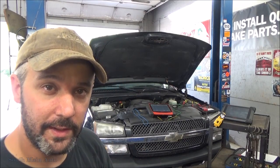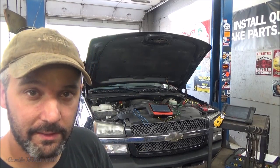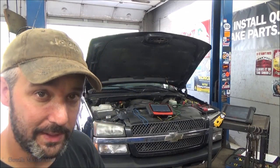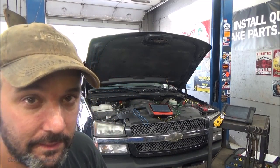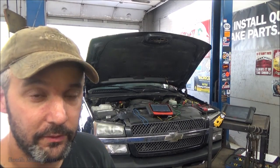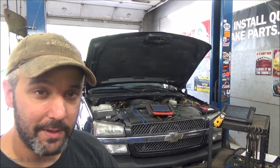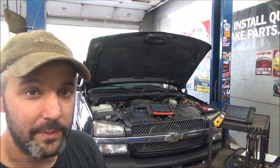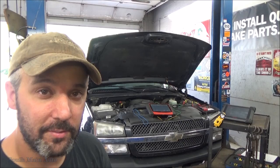It had a P0300 in it, misfire. It's got, I don't know, 130, 140,000 on it, something like that. So I'm thinking, probably plugs and wires, no big deal. Maybe a coil or something, who knows. But you know me, I will not just wing some parts at it because we think that's what it might be. So we wanted to get some definitive testing.